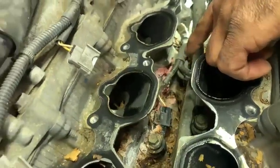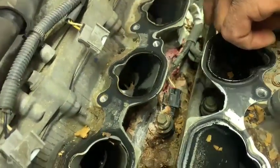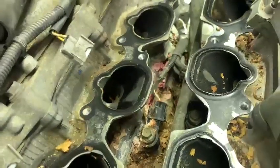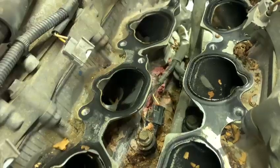And you see that pink? That's the beginning of a head gasket problem, that he's had some coolant leaking in there. We're going to get this all fixed up with the knock sensor code. We're going to warn him about the coolant. Get the car back on the road.